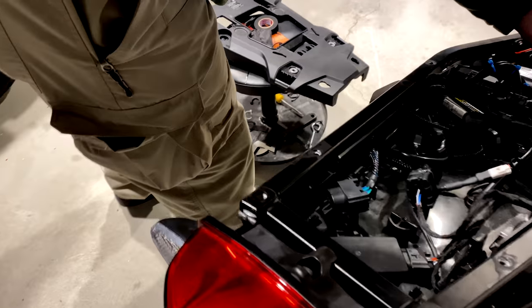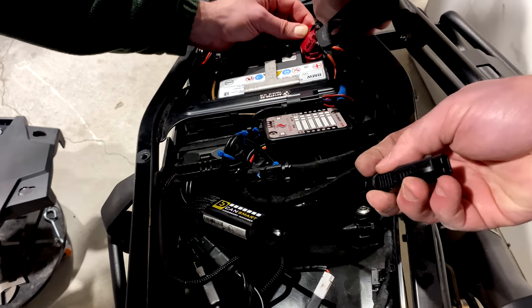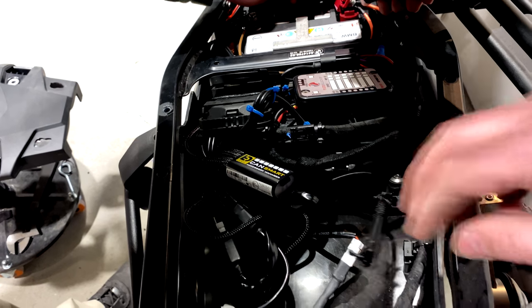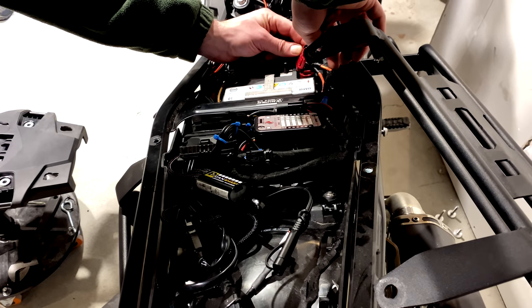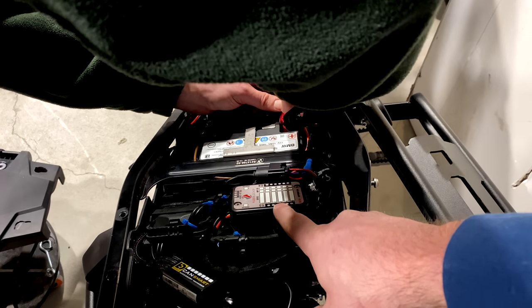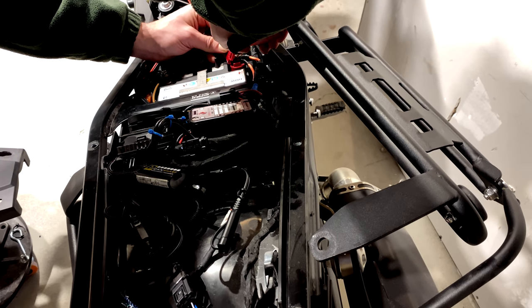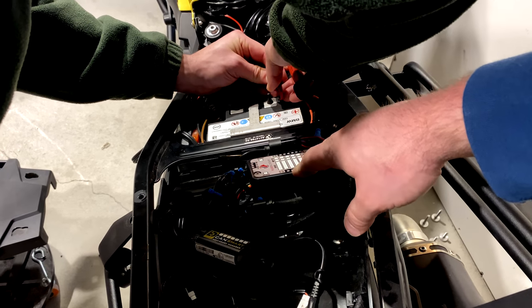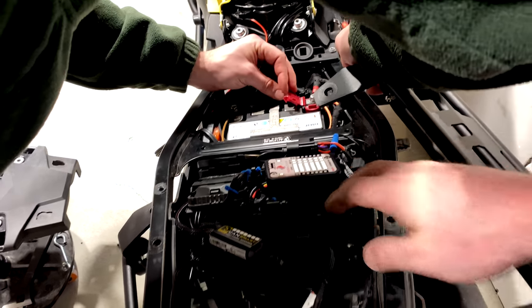That runs back to our trigger wire — the red and blue one right here. We've got a spare SAE, with two USB ports coming out of it, plus a permanent one down here, so we've actually got three total SAEs coming out of the fuse block: one on a 3 amp fuse, one on a 5 amp fuse, and one coming out of the battery for charging. Word of caution: if you're charging directly off the battery, you could come back to a dead battery after a few hours. That's why the trigger is in place — it tells the Fuseblock to wake up and start sending power only when the bike is on.